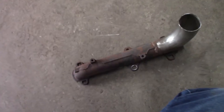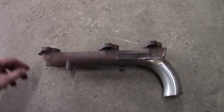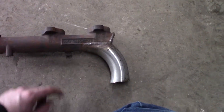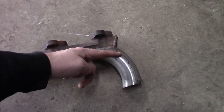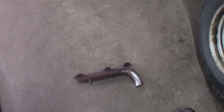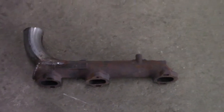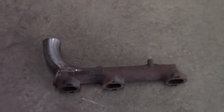So let's get started removing this manifold. I'll show you what I'm swapping in — this manifold here is originally from a 3500 Uplander front manifold. All I've done is cut the end off, kind of notched the manifold, and welded a little 90-degree pipe on there. I trimmed that and made it fit. I'm probably going to have to trim it back down a little more to get a flex in there. It is welded cast, but this later cast isn't quite 100% cast iron anymore so it should be a little easier to weld and should hold up alright.